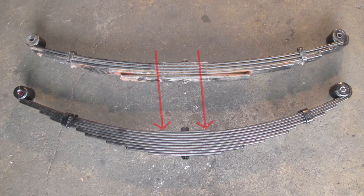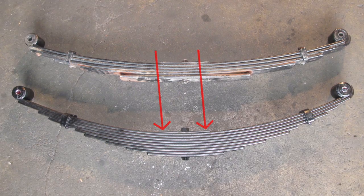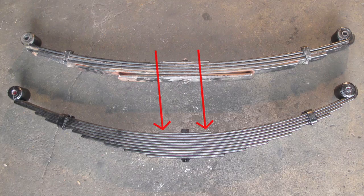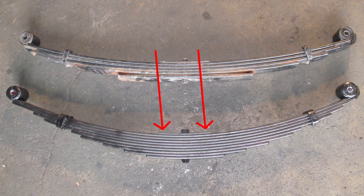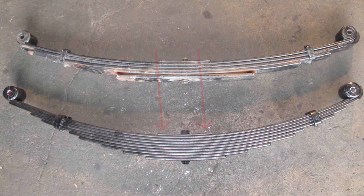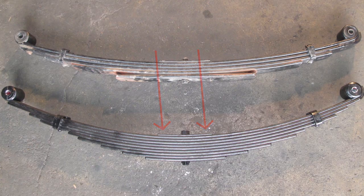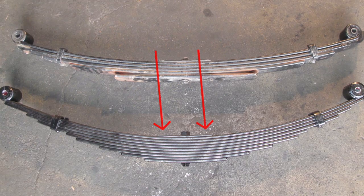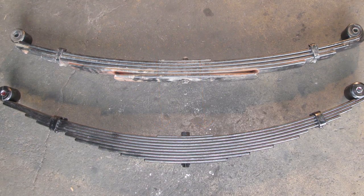Just look at the difference between the two springs. Our Bluemack spring is a more conventional front truck spring design, using more leaves with an altered main leaf length to allow more camber or height in the spring. There is no second stage leaf, which has been known to figure in breakages higher up in the pack when the primary lays backwards over the immovable secondary leaf under load.